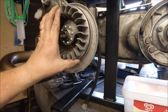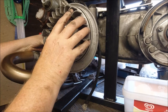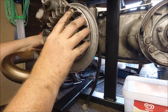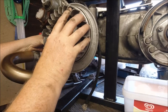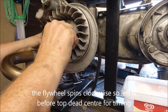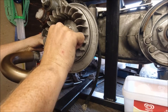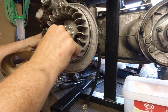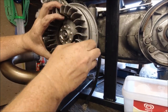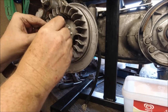I'll push that back on. That mark is top dead center and that is just before top dead center. That's quite easy to see where they've set the timing on this, so I can just tighten that up. I'm going to need the extractor again — I didn't think that would pull off with my hands but it has. At least I know where the markings are now.